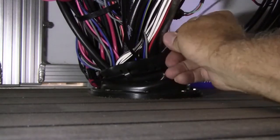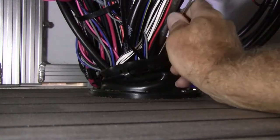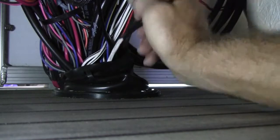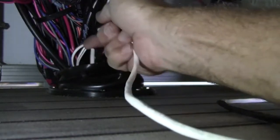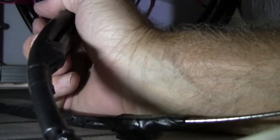If possible, try to use an existing penetration or boot in your boat's floor decking to bring all cabling into the helm and other areas where you plan to install components. You'll find it's much easier if you insert a stiff wire or wiring snake downward, then locate the wire underneath and attach the SideShift cabling to it using electrical tape. Then gently begin tugging your pull wire upward until you see the PT230's wires. If possible, have an extra pair of hands below deck feeding the wiring to you as you pull. You'll find the task much easier if you reduce any tape bulk by taping the thickest wire first, then taping the thinner wire to the thick one. Once your wiring is pulled, make sure to fasten any slack in wires that may come in contact with water.